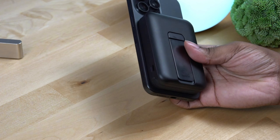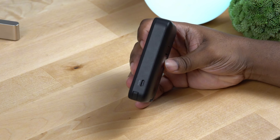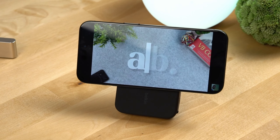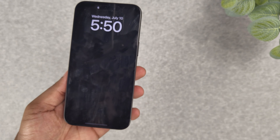Also remember that charging fluctuates throughout the charge. I would love to have the extra equipment to test live wattage, but I don't because I'm poor. Charging fluctuates depending on multiple things — like the temperature of the battery, because after a while the battery gets hot and slows down the charging, and the temperature of the phone, because doing intensive tasks like playing a game heats up the phone and the chip, slowing down the charging.